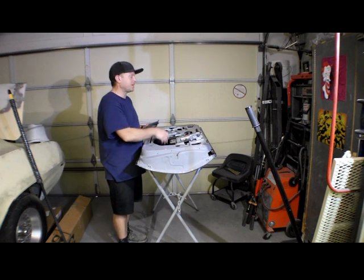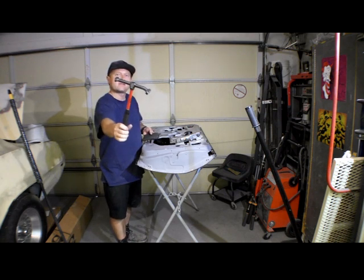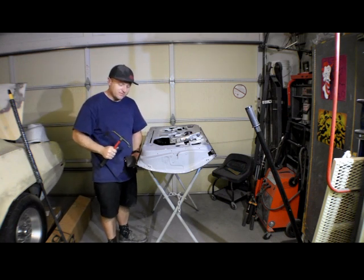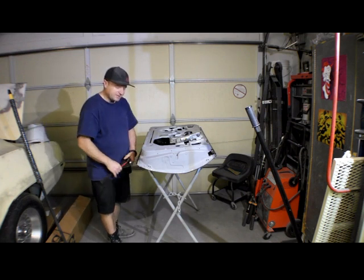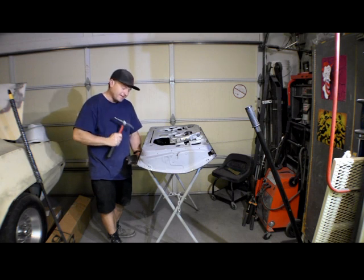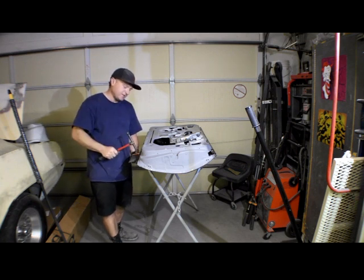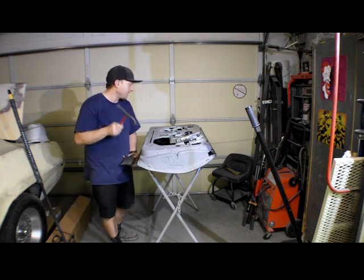After that, we took a doorskin hammer and a lead shot bag, and we started smacking over the flange for the hem. And I just lightly start getting it over at about a 45 and then bringing it down tighter than that. And when I'm hitting, I'm not just nailing straight, I'm trying to lightly walk it in.